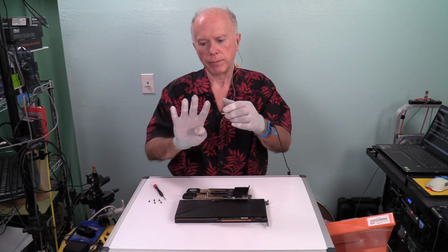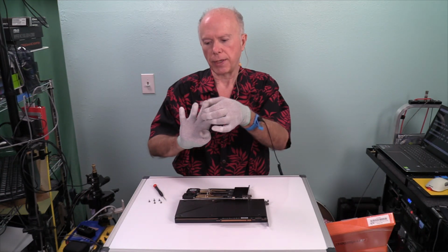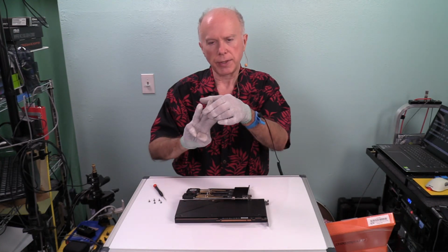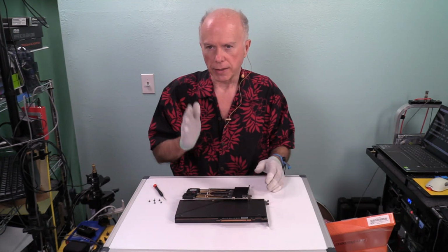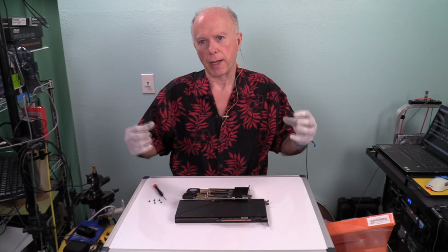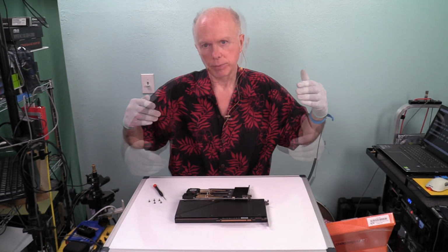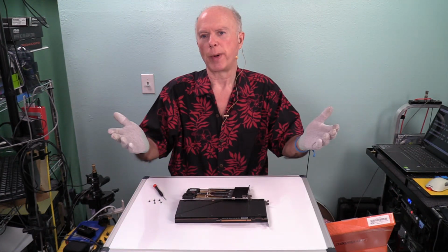4 drives in RAID theoretically would be 5, 10, 15, 20. Okay, 4 drives in RAID will be the speed of 3, which is 5, 10, 15. I explain it that way because I've had to go into that detail when I just gave the short form of that, and other people said, can you give some clarity on that? So I hope I just did.